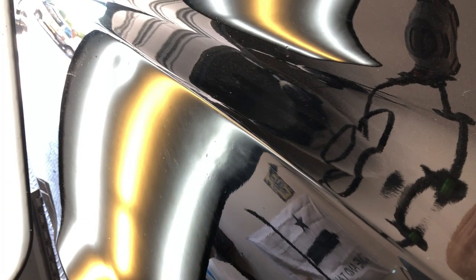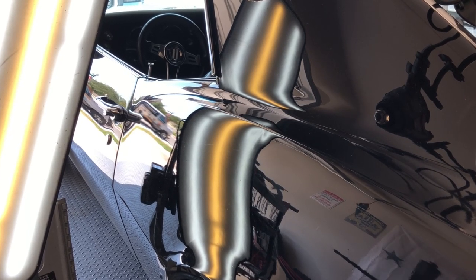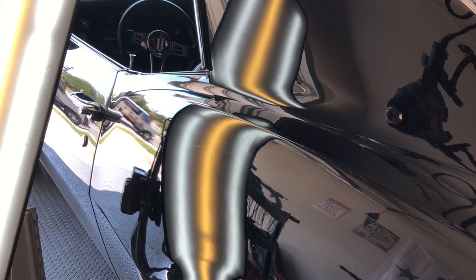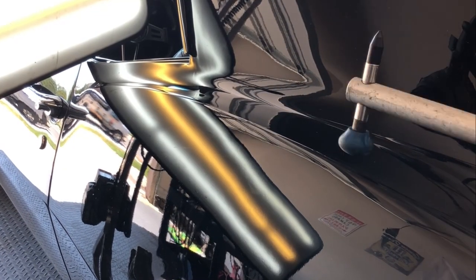Then I'm tapping it back down from the outside, and as I tap down I have to use the rubber — more blunt and softer — because the paint job was so soft we couldn't fine-tune with that. Here I'll leave it completely sped up in time-lapse so you can watch how this front dent just disappears. This is a great example of this technique — not something we do all the time, but I do have to do this on the backsides of some bedsides and other tough metals. This metal was perfect for this kind of technique: as that dent was dented in, it buckled up, and that's what cracked the paint. So I'm actually knocking down the part where it buckled up and cracked.